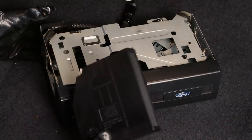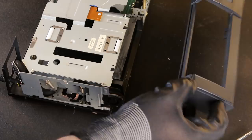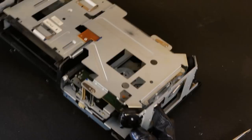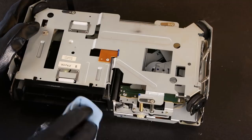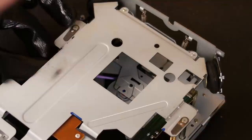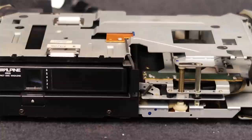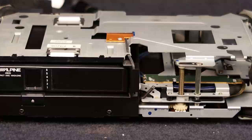So next I'm going to take off the face plate of this CD stacker so we can have a clearer look at the stacker internals. The first thing I noticed about the inside is that it is remarkably clean. There's only a little bit of dust around where the magazine enters the stacker. The other thing I noticed is it looks like it's going to be extremely complicated to disassemble this stacker any further. So I'm going to get a cleaning cloth and a bit of solution to wipe down any surfaces I can gain access to. I've also got a bit of lens cleaner on this Q-tip which I'm going to use to wipe the CD laser, which is located down in this little opening at the bottom of the drive. I've got a single CD loaded into the magazine and hopefully the stacker will be able to raise up and pull it out. And it appears to load the disc without any major problem.